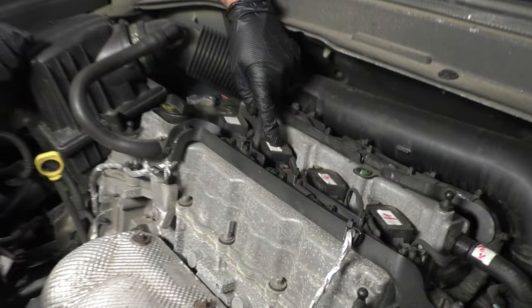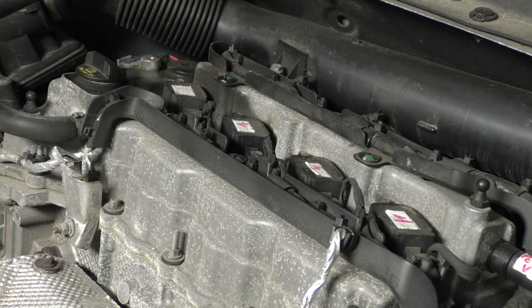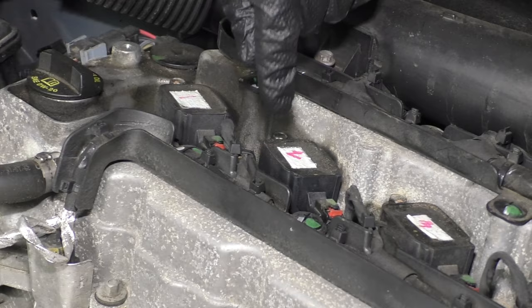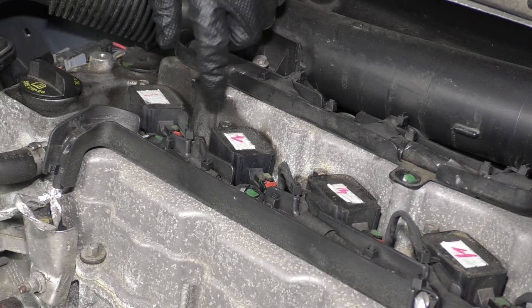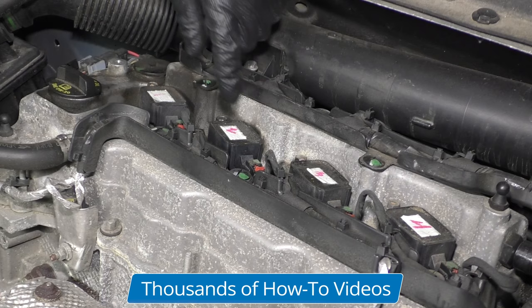Number one, the ignition coils. Now the ignition coils are located right here, and this is a four cylinder engine, so it has four coils. The symptoms you're going to find is a check engine light that most likely will be flashing, and the engine's going to be running rough. Now the reason why these coils fail a lot of the times is not so much the coil itself, but the boot that goes down to the plug. There's these tubes, and corrosion gets in there and causes the boots to not work as efficiently, so that's going to put more strain on the coil itself. Now, if you take the coil out and find that there's a lot of corrosion in there, you need to clean all that out. The boots most likely would need to be replaced, or replace the whole coil. They should come with the boots, and then it's always a good idea to replace the spark plugs whenever you have this issue.